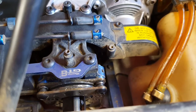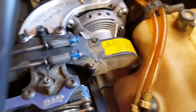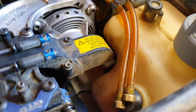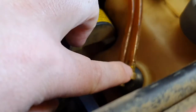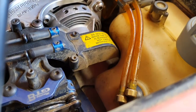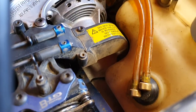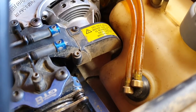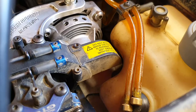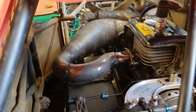The brakes are okay but they don't seem to do that well on it. The fuel system has been upgraded — I replaced the pipes because the original pipes went through a rubber grommet and it actually pinched and split. The new pipes are bigger with better flow, and I've never had an issue with that at all.